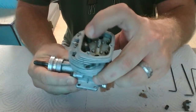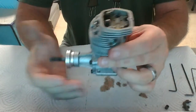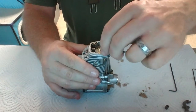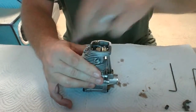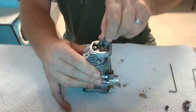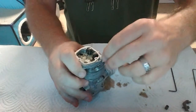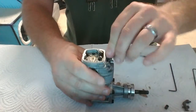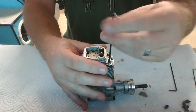They both feel like they've got really good spring tension. I don't know this engine's history, but when I had the head off the first time it looked really fresh — like maybe it had a few tanks on it, if even that. The exhaust valve had some carbon buildup on it but the intake valve looked brand new. Let me loosen these head screws up — we'll loosen them in a diagonal pattern.